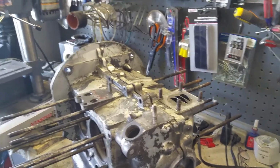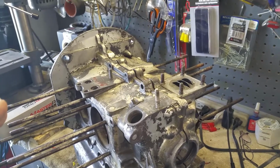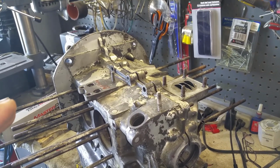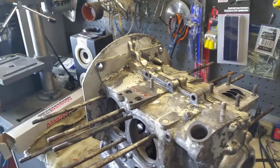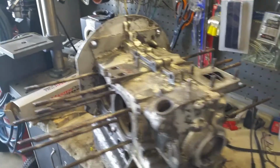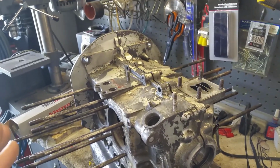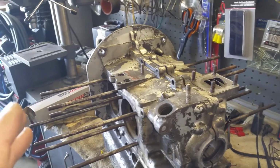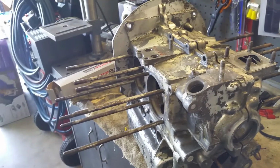No. I just saw my valve train. Oh my God, it is perfect. And I've got an FK42 cam, which is horrible on the valve train. All the FK series are the worst cams for your valve train, but they make a lot of power. They're really hard on it. And I'm telling you, my cam bearings look like brand spanking new. Even my thrust bearing was perfect because I polished the surface on the thrust cam.